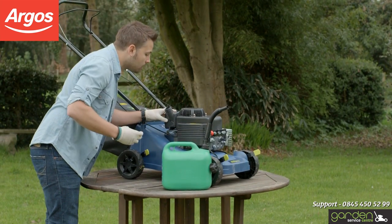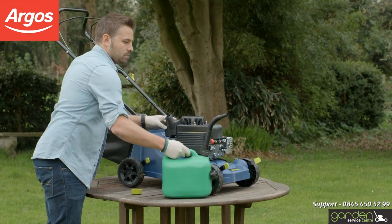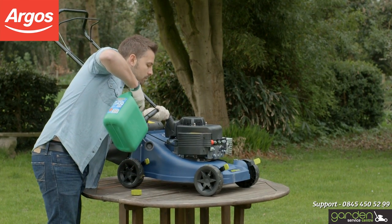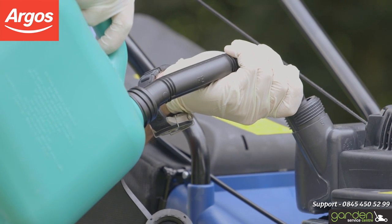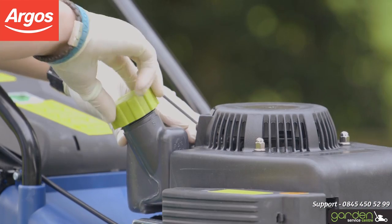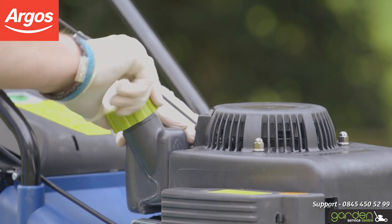Refill the tank using fresh, unleaded petrol following the instructions in your user guide. Make sure not to overfill the mower. As a rule, there should never be any fuel within the filling neck. Clean up any splashes or overflowed petrol and replace the filler cap. Make sure the cap is finger tight.